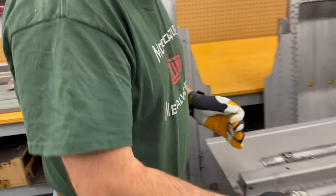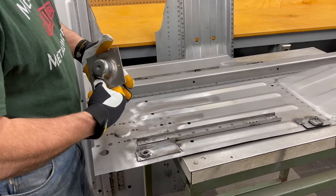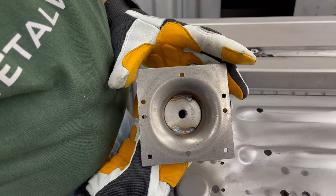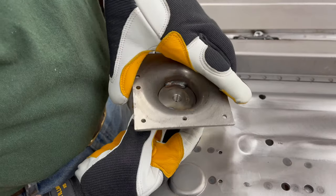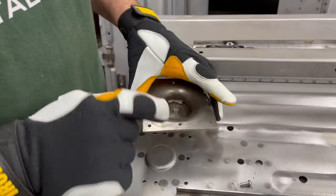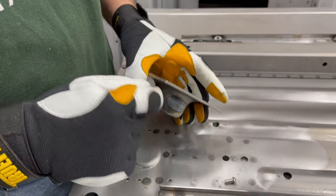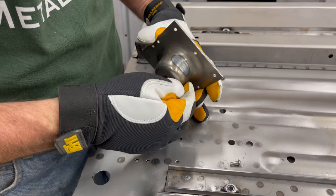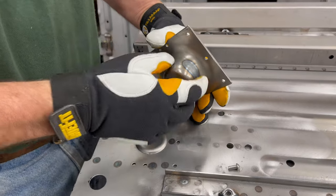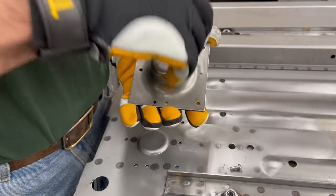Here's our new radius cup. When you buy these new, you've got to be careful. See this weld here? This is where they weld the bung inside the radius cup, and it's been done with a TIG welder, so it's in there and it hasn't distorted the cup. Another manufacturer does this with a MIG, and to MIG this eighth-inch thick plate to a super heavy half-inch thick bung, they've got to really crank it up. When they do, you don't get a little blue mark - you get a blue lump of distortion and you can't get the radius cup on. So if you end up with a pair like that, check it out while you've still got it on the bench. Grind it down some with a sanding disc and make sure your radius cup is going to fit.